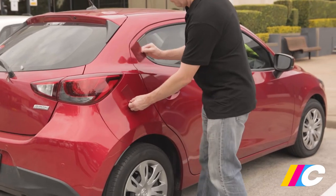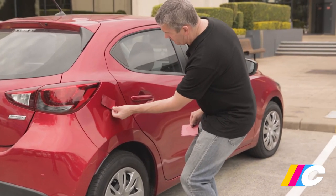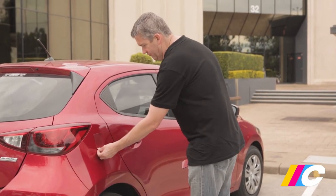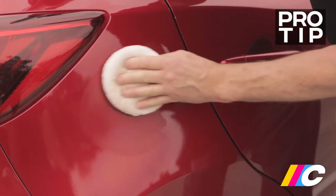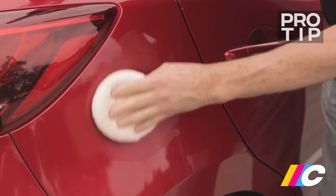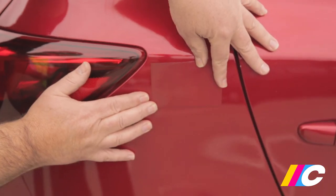After the clear is dried, hold the cards against the panel to determine whether two, three, four, or five layers of pearl is the best match to your car's factory paint. Outside in natural sunlight is the best place to do this. Exposure to UV fades all paint, so to ensure your existing paint is close to its original color, give the test area a quick polish with Meguiar's cutting compound.